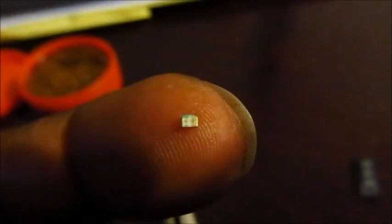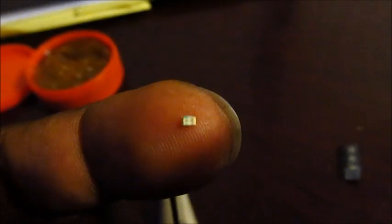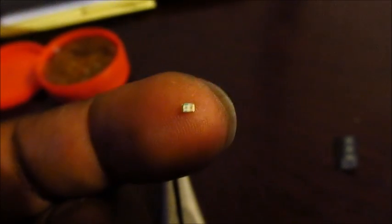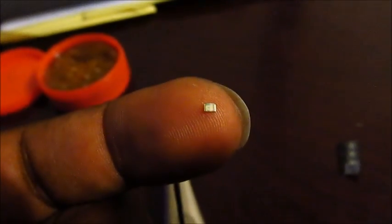Okay, what we have here is one SMD LED. This is the back side. I don't know if you have enough light to be able to see it there. So what I'm going to actually do here is pick it up and show you the front side. Now, these all need to be orientated in a particular fashion. If you look at the left side of your screen, you can barely see it, there's a green little dot. All of those dots should line up with every LED that you lay down on the needle nose pliers. One side is the anode, one side is cathode, positive and negative. Right now I don't remember, but I know on digikey.com when you order it, they have the data sheet for every part which indicates which side is positive and which side is negative. So give me a second and I'll line these up for you.